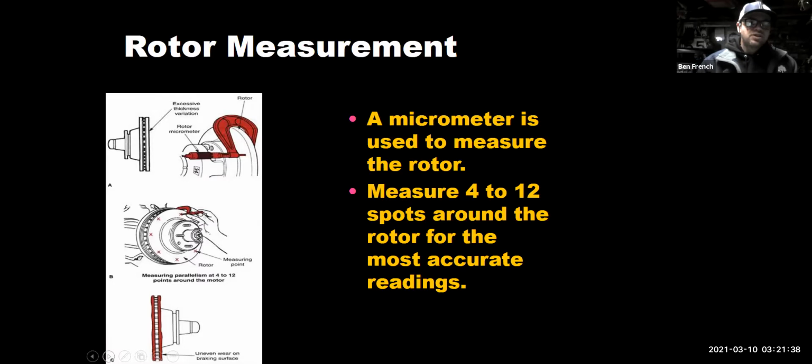Okay. So if you've got vibration issues when you're stepping on the brake pedal, but you don't have the vibration when you're not on the brake pedal, that's a sign of what we're just going to lump into the category of warped brake rotors. And the common fix would be to replace the brake rotors. And if you're replacing the brake rotors, I bet the pads aren't in fantastic shape, and you're probably looking at rotors and pads. Okay, if you're doing that work, you should probably be flushing out your brake system as well to get some fresh fluid in there.